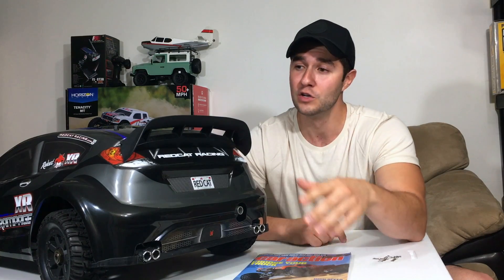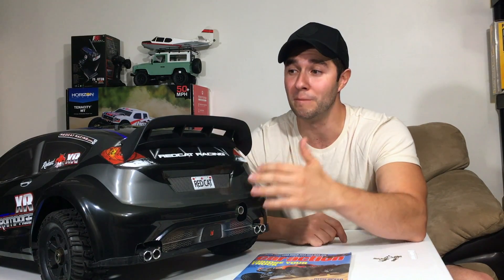The engine RPM barely peaked 13,000 RPM. Based on my calculations, every 250 RPM should be 1 mile an hour. So I'm basically missing about 3,000 RPM — that means I have 12 extra miles per hour to really be gained. Theoretically, this actually should be the same speed as my 30cc Rovin gas Baja, but these things just do not give the RPM.